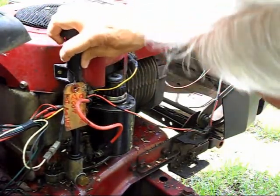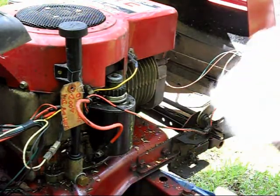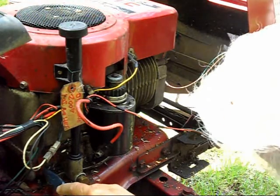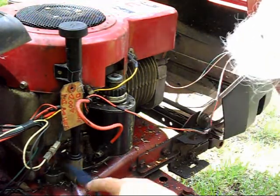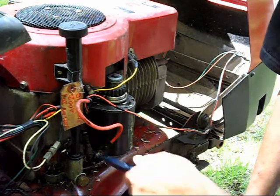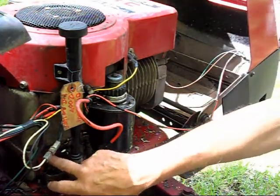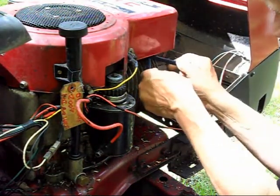You've got to unhook the oil thing and then you run the risk of having a leak in the seal. The leak I got here is between the bottom block of the oil sump area and the block keeps loosening up. One time it loosened up so bad that it sounded like the engine was knocking but it was just banging together. So I tightened it up and then I had to put some RTV in there to keep it because the gasket was so thin it leaked oil.